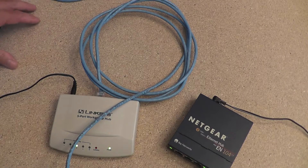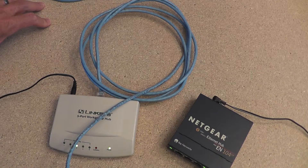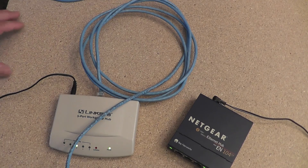In the IT world, it's always best to get as much use as you can out of your devices and not be quick to send them off to recycling — unless you're working for a large company with very deep pockets. Things have to last a while. So that's what I wanted to show you: how to daisy chain a couple of hubs together, either with a straight-through cable through the proper ports or with a crossover cable through the proper ports. If you plug things in and don't get the lights, try again. When the lights come on, things are good — but if you know what you're doing, you should be able to plug things in once and know when the lights will come on.